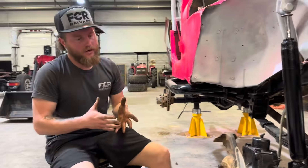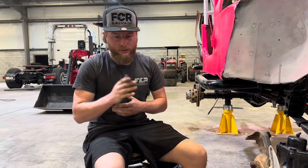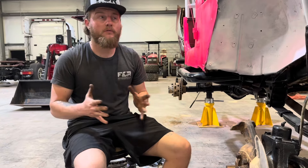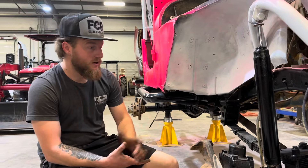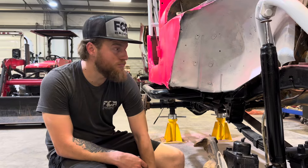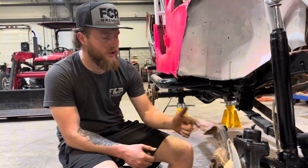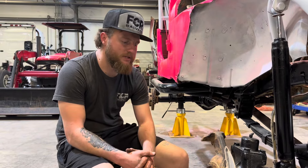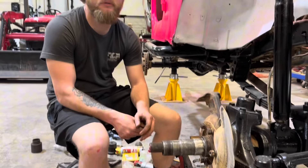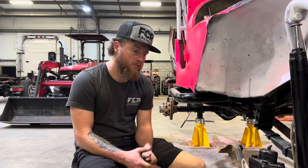Alright, now it's ready to go on. Now we put the bearings on, put the hub on, put the locking hub on, put the caliper on. Then we might be able to do brakes next. I'm going to try and flush out all these lines and maybe get the calipers on. I might have to put 2-inch wheel spacers in the front — I really don't want to grind down a brand new caliper so that the 15s will fit. I don't have 17s right now, so I'm thinking I'm just going to put 2-inch wheel spacers on the front.